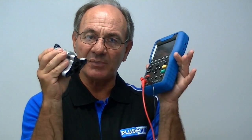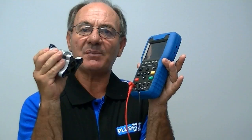The EGR valve position sensor is a test that requires a suitable oscilloscope to monitor the sensor's operation and position. The EQP115 is required during this test to create the movement of the EGR valve itself, so the output of the EGR position sensor can be monitored during this movement. This ensures a total EGR assembly test.